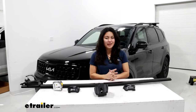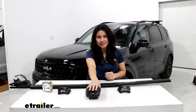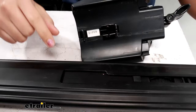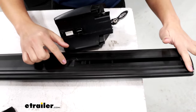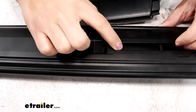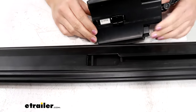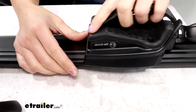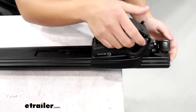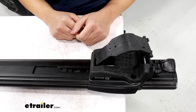The install process is very simple, although not entirely intuitive. Follow me as we get the tower set up onto the crossbar first. Notice the tabs on your tower, or foot pack — these need to enter into the crossbar. You do not need to remove the end cap; you just need to slide this track through. Once it gets to this point, press down and then continue sliding it through until you open up that section. Now you can fit your tower onto that open area and pull the tower out. If you're having issues, go ahead and press in on that strap — that might help. But that's it: your tower is now attached.